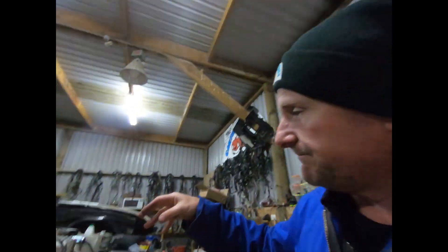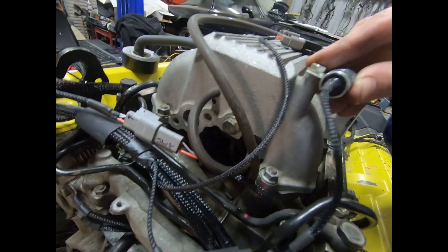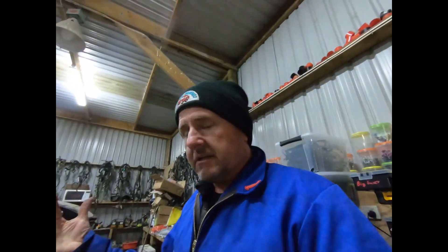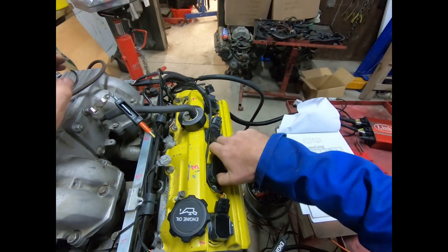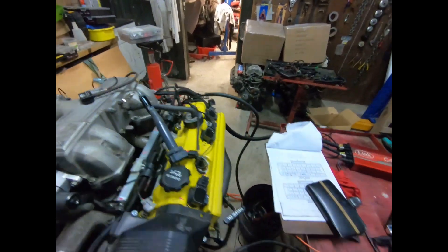One thing I've also done on this one is I've added a suppressor to the coil circuit, to the power feed. It's mounted up here at the moment — it'll eventually be mounted in the manifold under the plenum so you won't see it, just with a plug coming out. That helps with interference and static going back to the radio. The G4 Plus units don't generally have that problem either. Because I didn't store that setting by just turning the power off, it reset back to default off.